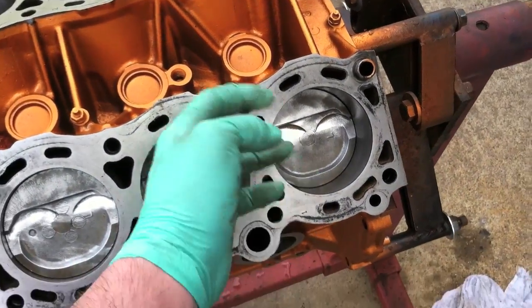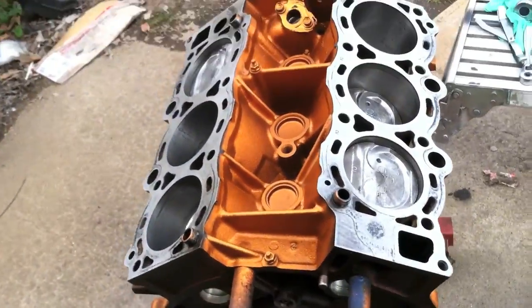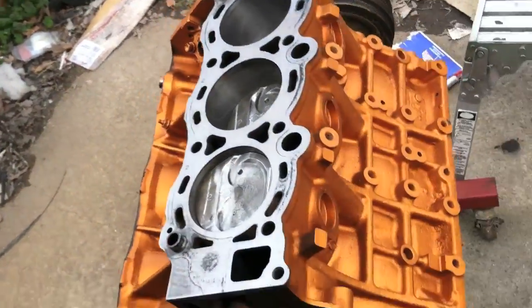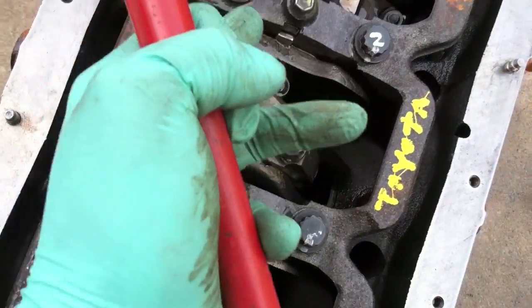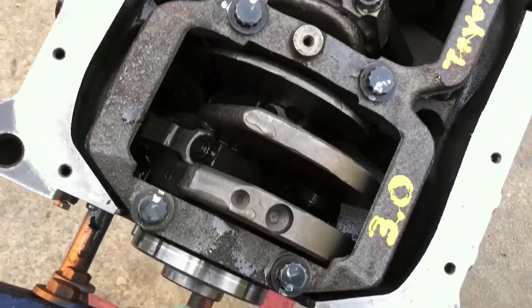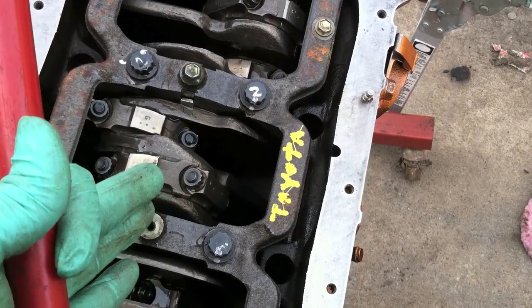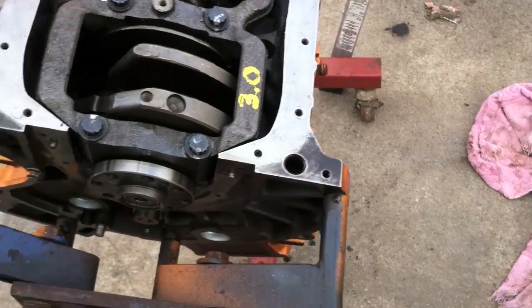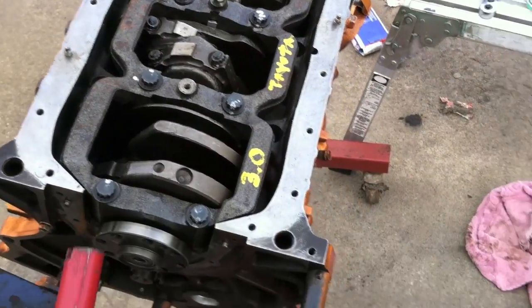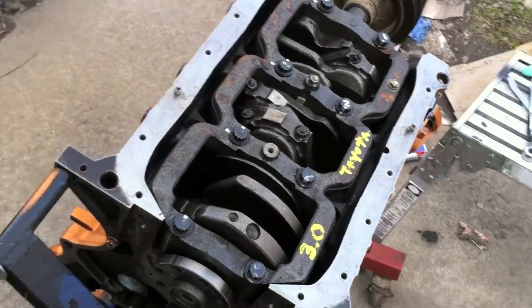Store it and put some oil on your finger down into the grooves and cylinder walls to keep them from rusting. I also used Lucas engine assembly lube and put some motor oil between all the joints so it wasn't dry while spinning. Once everything is torqued — the 18 foot-pounds and then the 90-degree second step — spin it with oil around it and everything should be fine. Stay tuned for the next steps; I've got some cool things planned for this motor.